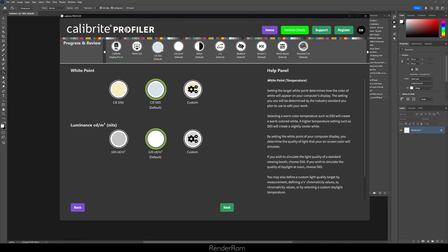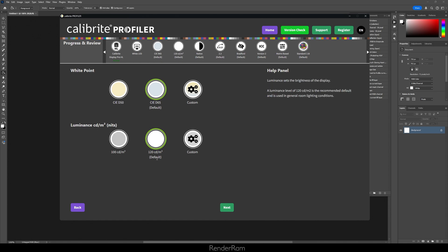One interesting thing about calibration is luminance. Maximum perfection in monitor calibration is typically done at low brightness — the recommended target is around 120 cd/m², which has always been a kind of default. I got used to working on brighter monitors, so 120 was very dark for me. But at some point I decided to go with 120, found it super dark at first, stepped away, and returned to find it looked normal. So if you prefer a brighter monitor, give 120 a go and give it some time — you might adjust.